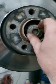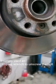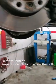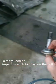Next thing you want to do, remove this center bolt that holds the driveshaft in place. Watch out for that spring — you don't want to lose this. Put it aside.